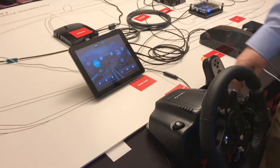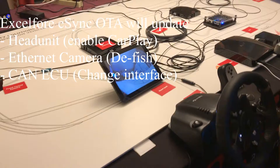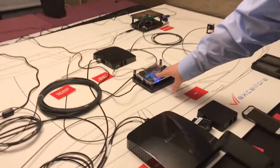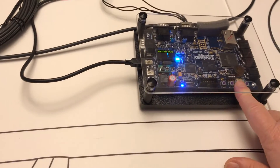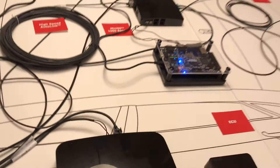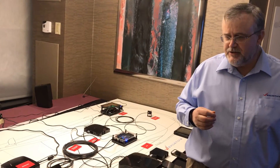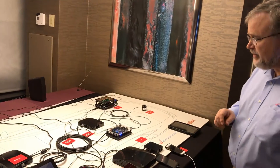Other things I want to do in the over-the-air update: we had looked at the front camera, and its function — you may have noticed the fisheye lens effect. So perhaps I would like to resolve that as well, and I will download software to do a defisheye correction in the camera so that we have a better view. I will also download a new user interface to this ECU, which is functioning as a tire pressure monitor. When checking the pressure of individual tires it gives the symbol of an exclamation point to indicate those tires are correctly inflated — but the consumer perceives an exclamation point as a warning symbol. So now we want to update that to use a different symbol for good status, and we'll do that through the over-the-air update as well.